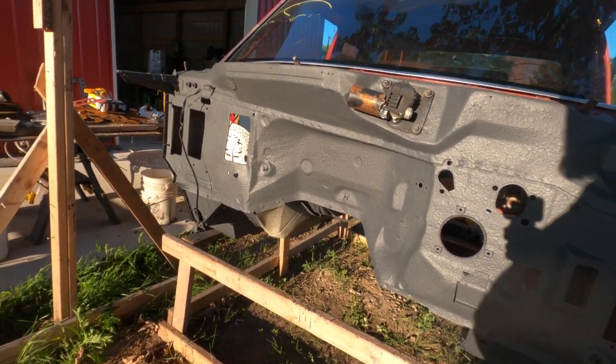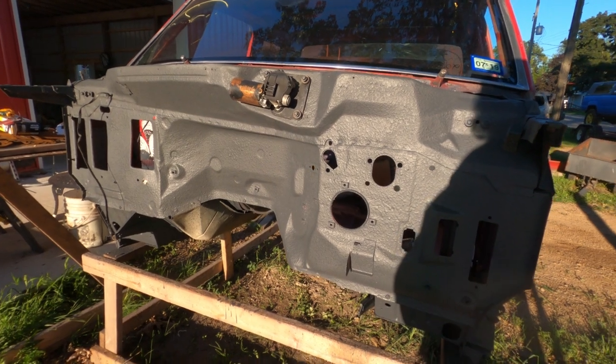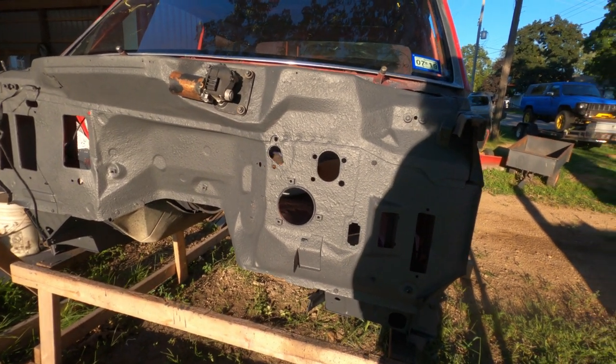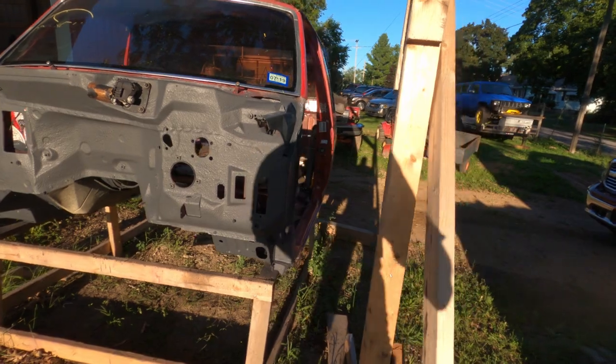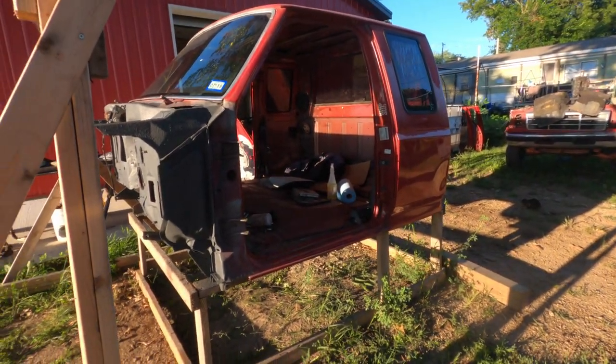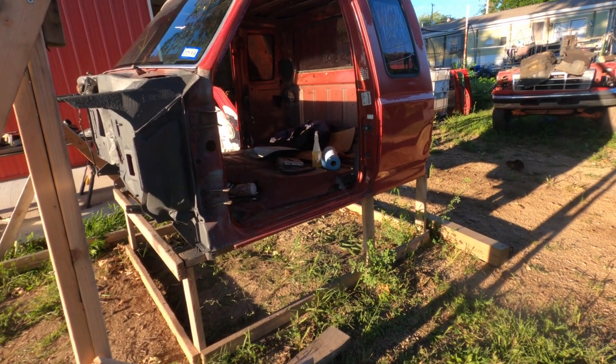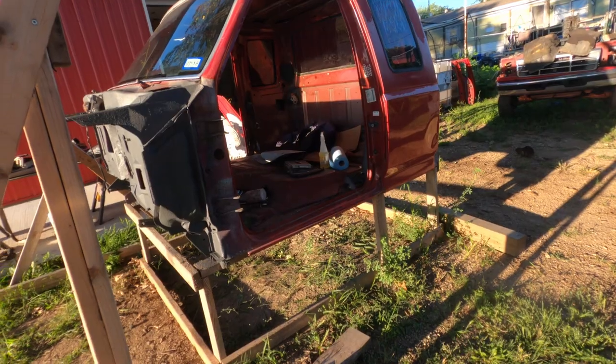With the micro balloons I was able to get about a gallon of sprayable material, which was enough to do the firewall in two coats and the floorboard in two coats — and this is a super cab, so it's a little bigger. I'm probably going to do the inside the same way, maybe with some color added.